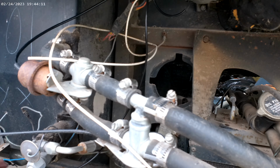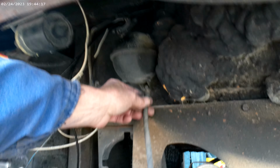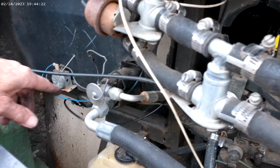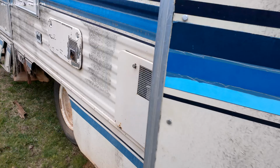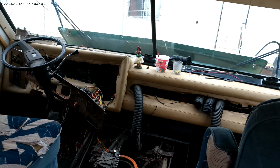And like I say, white, black coming out of your vacuum source, engine vacuum to the reserve bottle. Vacuum source, control, another control, and the green control in the dash there, and the red control in the dash. This pretty much leaves you no other alternative but the orange. Orange goes right there to the water valve out on the front end. So I'm pretty sure that's all of them. Pretty sure it is.